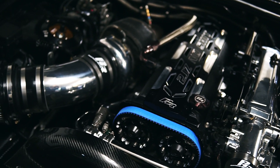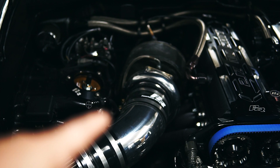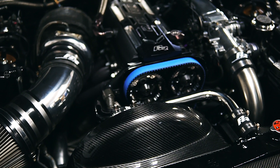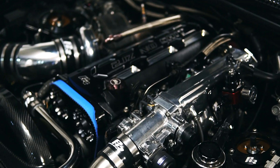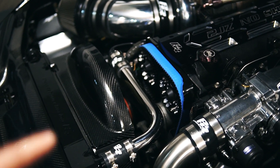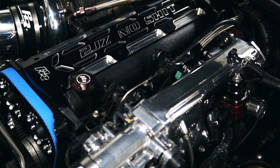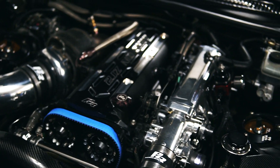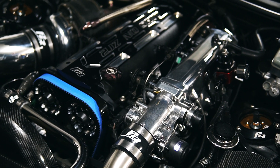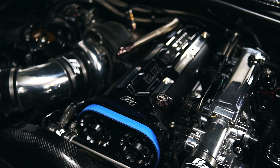At this point I think it's time to finally go to a real standalone unit. The piggyback has worked for years but I think I'm finally getting to the point where it's reaching its limits. The last thing to do is upgrade the turbo — I have a 76/75 I want to put on here; this is currently the 67/66. This is essentially a stock bottom end with the upgraded head, a Precision 67/66, ID1300s, and a PHR double pump fuel hanger. At around 29-30 pounds of boost this car made a little under 740 horsepower — all on the stock ECU with a piggyback and on E85 fuel.